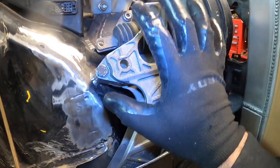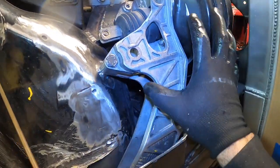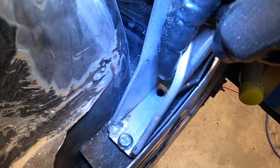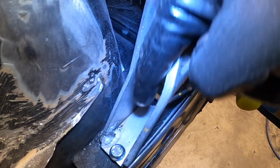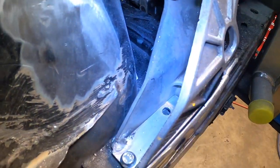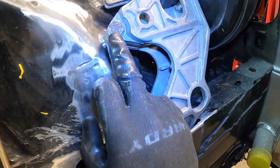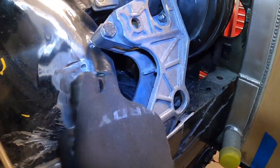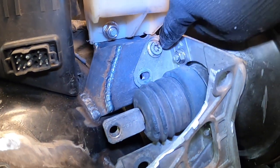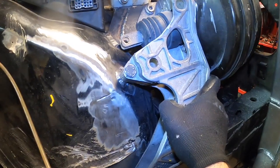What I've done here was basically strengthen all of the structural points where the brake system mounts to the chassis. In particular, two bolts — one of them isn't installed right now — but both bolts have been added to an aluminum fixture below that I had welded down. So this thing is sitting really good on two bolts. This guy is a 17 millimeter shoulder bolt, also screwed to the chassis. And there are two additional bolts that need to be screwed down to this location. So this is on and it ain't going anywhere.